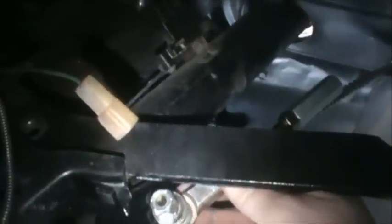So we're going to go ahead and do that now, and we'll also take our clutch right here, and I'm just going to get in here with a little cutting tool, and I'm just going to cut this thing off altogether. Now you can unassemble this and all that and cut it off and put it all back together, but you're still going to need a spacer in for where this clutch used to be, so you can't just take it out altogether, or it'll make this whole assembly a little bit floppy.